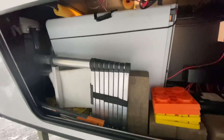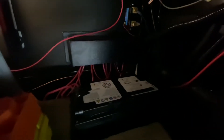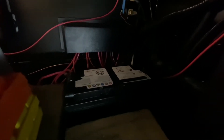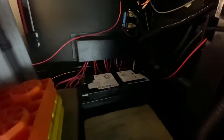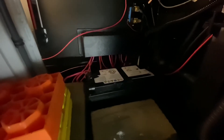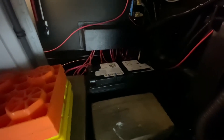A couple of simple mods we've done already: we added a circuit breaker for the solar panel - I'll put a link below for that. We put the Victron smart shunt in, Bluetooth, so we can see what power is being consumed. Right now I've put a small 70-amp lithium-ion battery in here, because we've already installed the lithium battery charger and it didn't show specs for charging a normal battery, so rather than destroy the lead-acid 100-amp that came with it - yes, a 100-amp lead-acid - a tiny thing that wouldn't do anything for us.